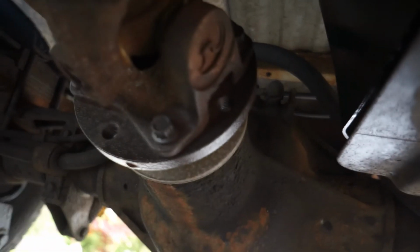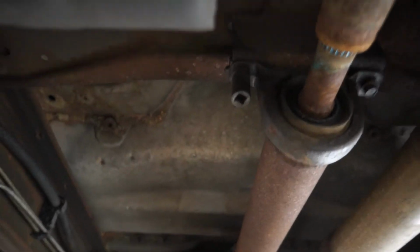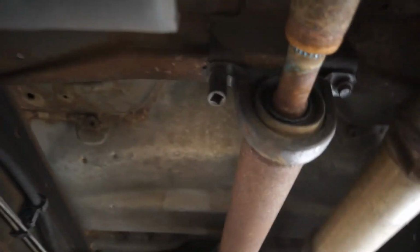And we'll see if you guys can see right there the drive shaft going back into that rear right there. And there's 4 more of those other 12-point bolts that you're gonna need the 12-point socket for right there. So June's going to get a hammer to tap this socket up onto the carrier bearing bolt. We're gonna get this thing off of here.